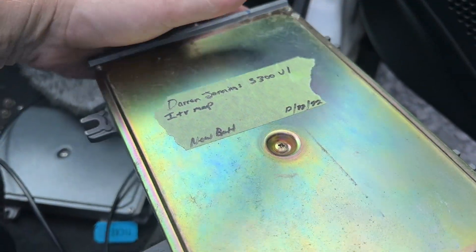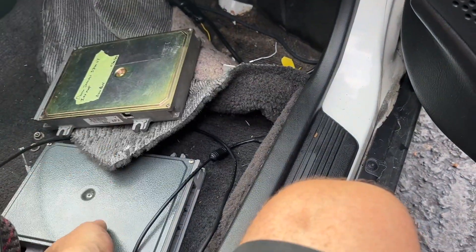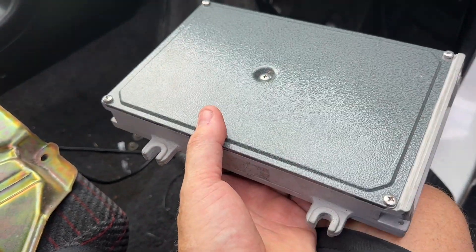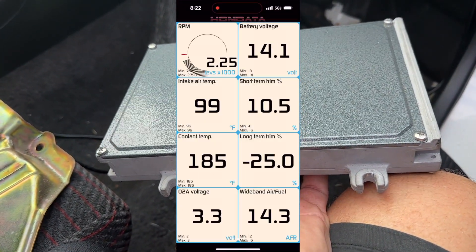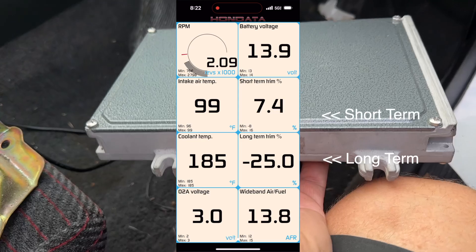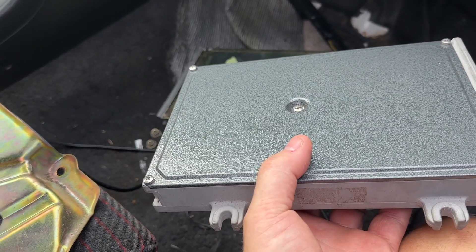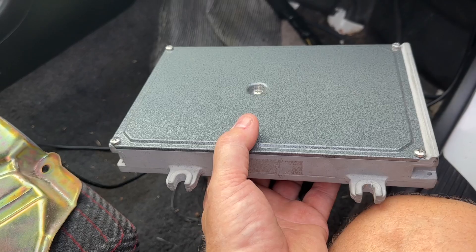To describe what was going on: the car would be pulling fuel on the long-term trim and then trying to put it back on the short-term trim. This is the ECU — I'm not sure what it is that went wrong. The funny thing is it did this in open or closed loop. I would pull the laptop out, turn the O2 off, and it would do the same thing — I've never seen this before. Short-term and long-term trims are kind of like a memory. If your tune is 20% off, short-term trim will be putting 20% either in or taking it out. Long-term trim was at negative 25 and the positive trim was trying to put it back in because at negative 25 the car was falling on its face, and on top of that I was getting random misfires.